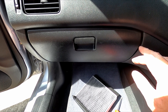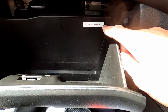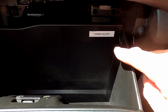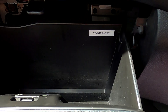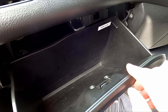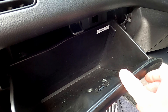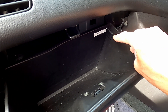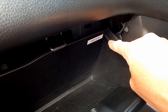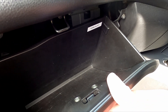The cabin air filter is just located behind the glove box. You'll notice I've put a label up here showing when the cabin filter was last changed — that was back in June 2019 — so it'll be interesting to see how dirty this filter is. To access the cabin air filter we just need to remove this glove box and locate this little tab here. This little tab is a removable tab and it's designed to stop the glove box from falling forward.